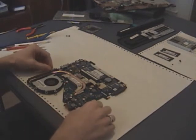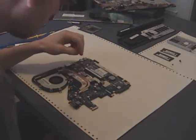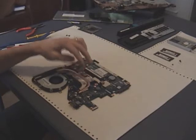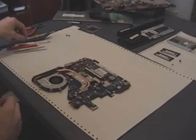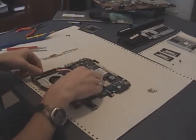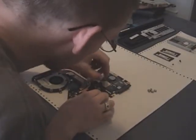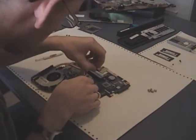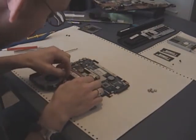Here's our processor. You can see it's got four silver screws holding it in and then another black screw on the side that actually holds it in the socket. These four silver screws are going to allow us to take the heat sink and fan off and physically get to the processor. Once those are off you should be able to lift the heat sink and fan away. When you start to pull it away you'll see there's a little connector for the fan.